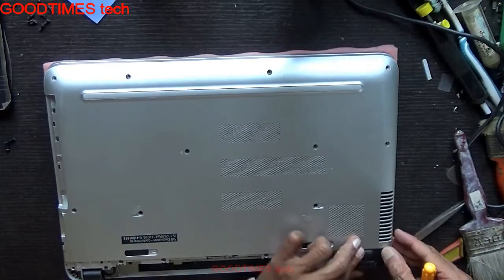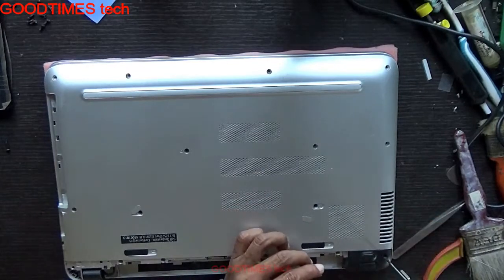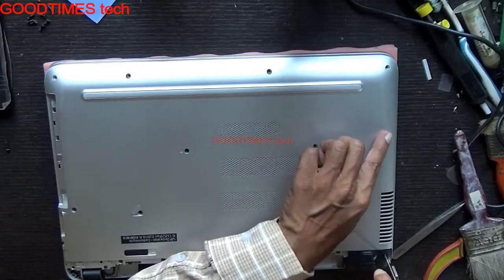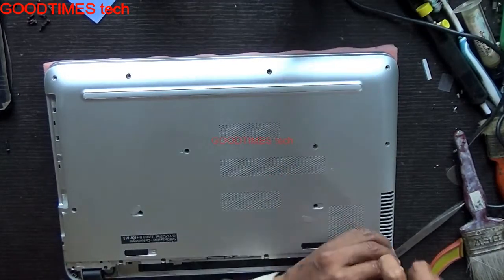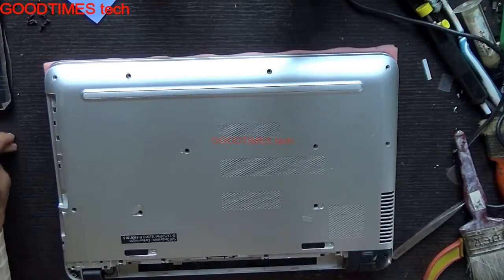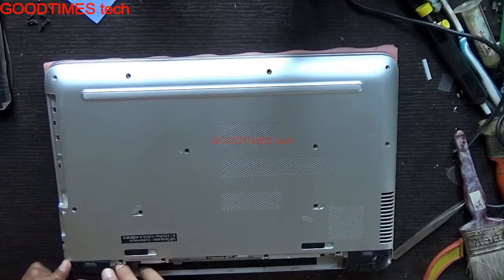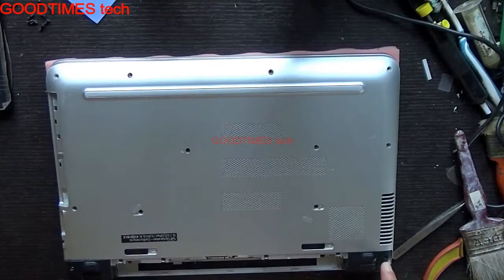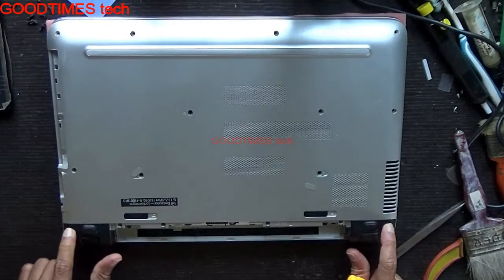Lock them by pressing. The two lengthy screws will be fastened exactly here at these two corners. If you put them anywhere else, they will come through the front — through the touchpad panel — and protrude out of the front panel. Keep in mind these two lengthy screws are to be mounted only at these two corners.